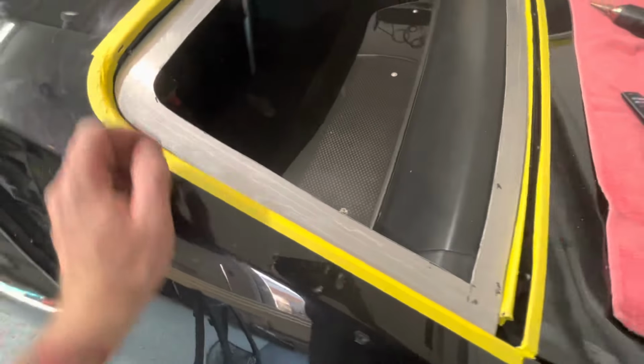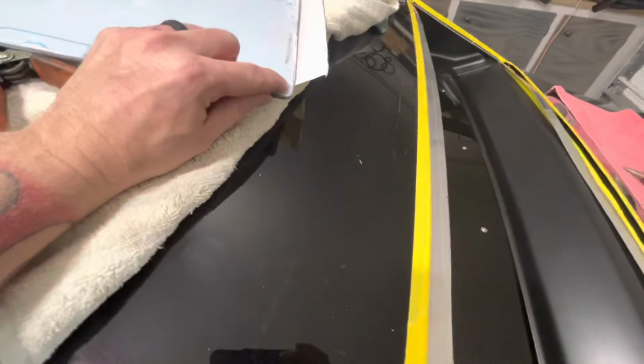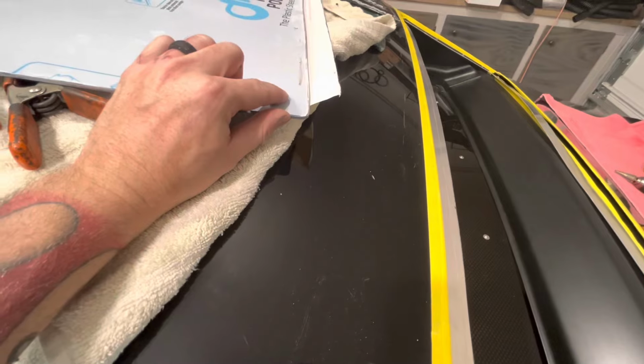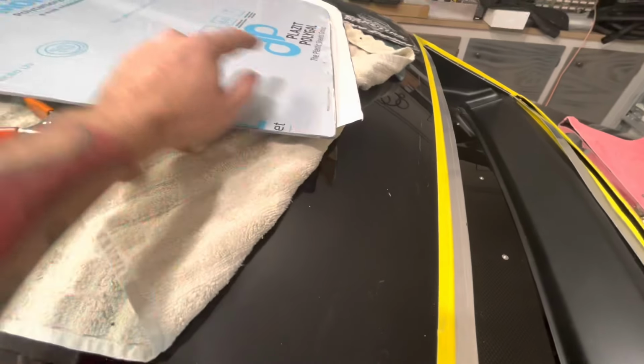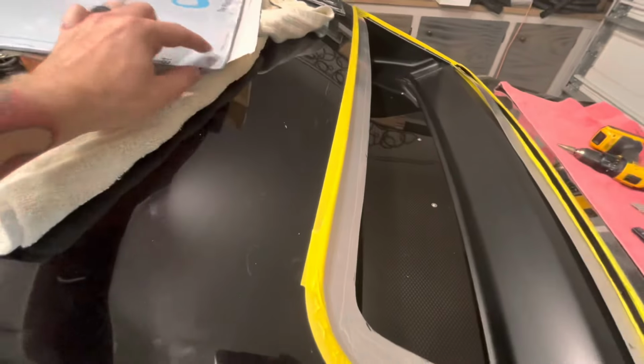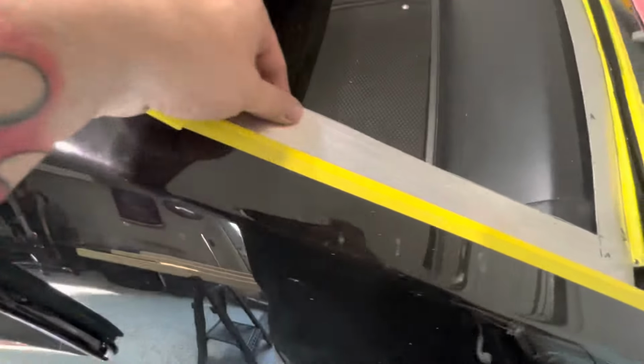That way, again, the whole point of this is so that your screws are not really close to the end of the Lexan, to make it stronger. If your screws are more in here, it's way, way less likely to crack. A hole way in here is not gonna crack nowhere near as easy as a hole near the edge. So the farther away you can get your screw space, the better.